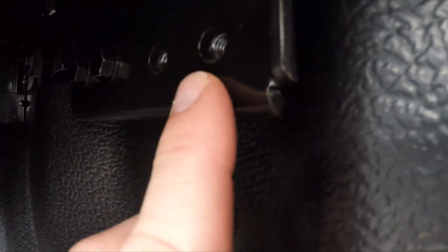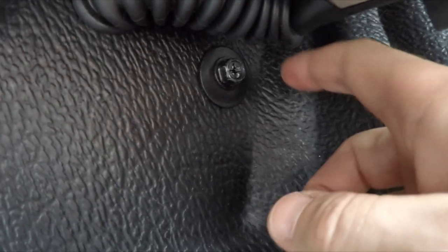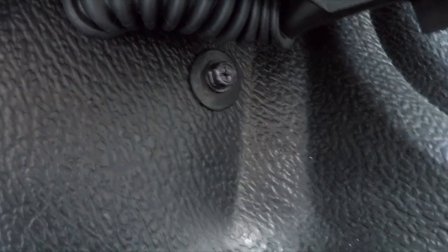In the front of the tub, just above the wheel arch, there is a black plate and we're going to put one in there — there are some holes already. Underneath here we're going to remove that with a 12mm socket and put one in there. I've already done the other side, so let's go over there and have a look.